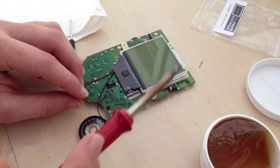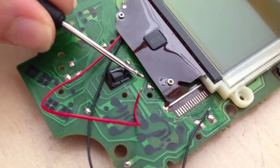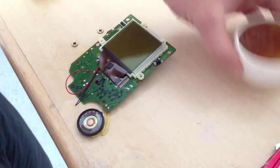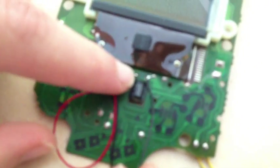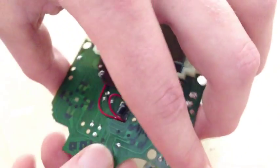Once you have the two screws back on, we are going to do some soldering. We are going to prepare our spots — put a little bit of rubbing alcohol on these two contact points: positive right here and negative right here. We are going to solder it up — red wire for positive. Once we have the two solder points connected, positive to this point and negative to this point, I like to tuck the wires through this resistor hole just to get them out of the way.